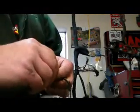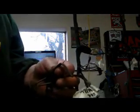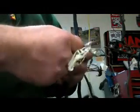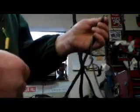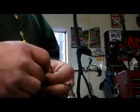So I'm going to solder the terminal on. This was the alternator terminal, so I'm going to solder the terminal on after I put my heat shrink on, because I keep forgetting that. Old age, I reckon. And then we'll have plenty of capacity in the cabling for the alternator. And if we want any accessories, this cable will basically run back. The brown one, the additional one, will run back to the battery via the starter switch.